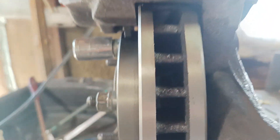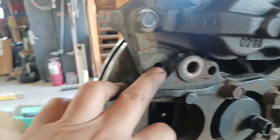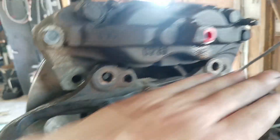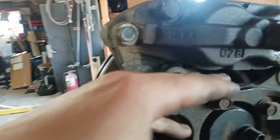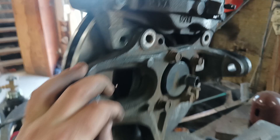The rotor is tight to the knuckle, but it's not touching and it should never deflect. If any of these deflect, it means I've crashed. It's just a little bit of an offset hole, so we're going to put a piece of maybe 3/8ths material, because I think a quarter is a little too thin — just to have that safety factor.